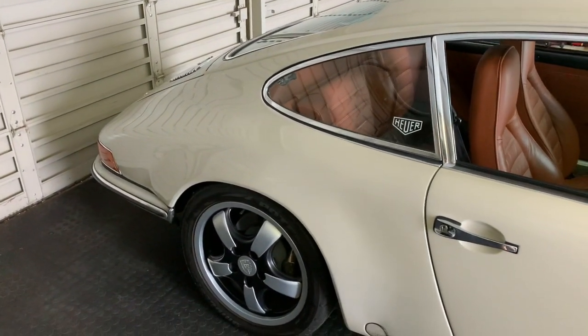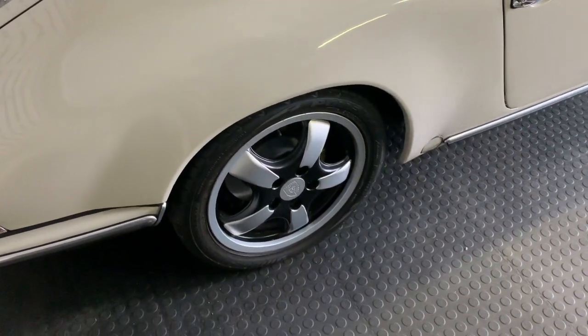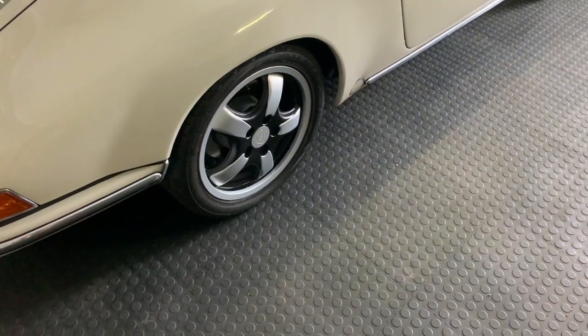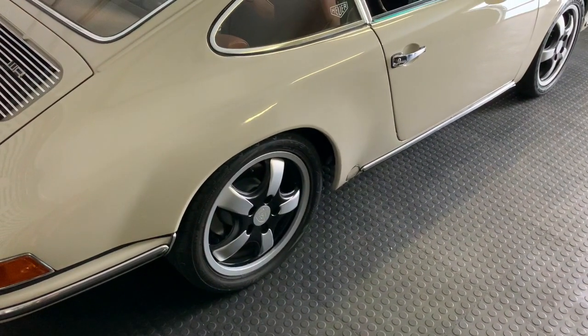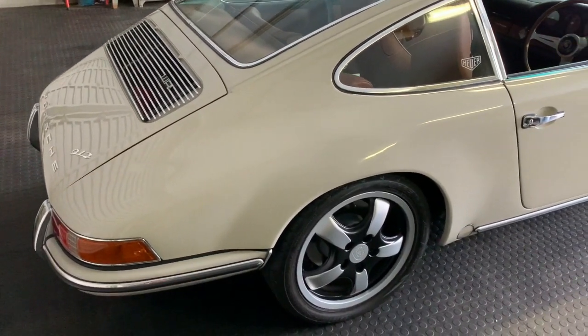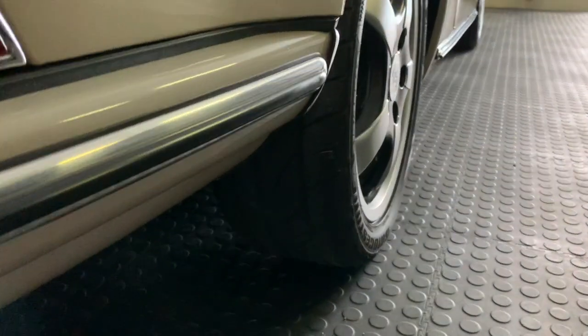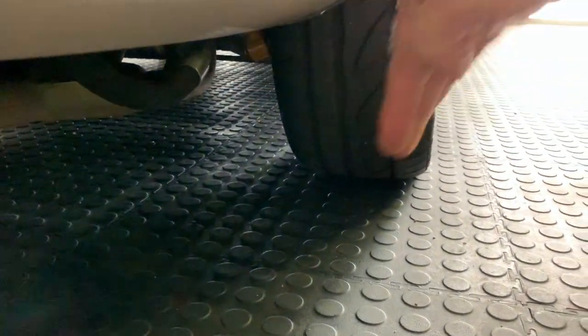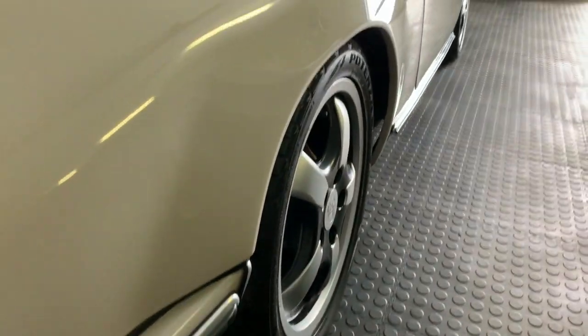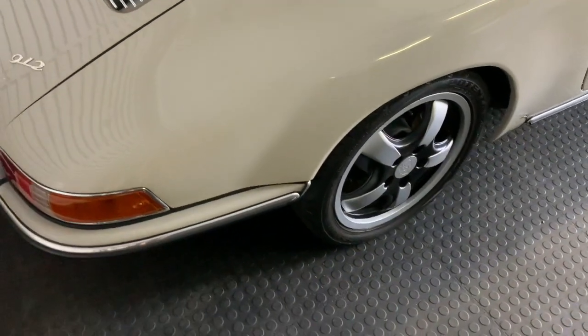And what a lot of people don't know is, I took the lead from the American muscle car market, where they have very classic cars, and the only way that they give away the fact that the car is in some way modified is by way of a contemporary wheel. What they also tend to do in the American muscle cars is widen those wheels to the inside, that way, instead of this way. And what that does is it retains the classic lines of a car, and at the same time gives you the increased traction of a wider wheel at the rear.